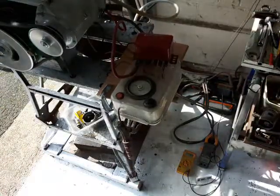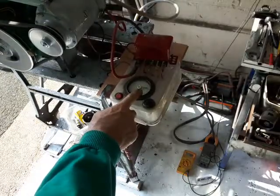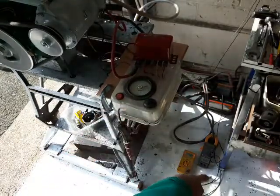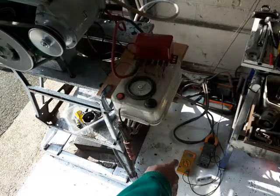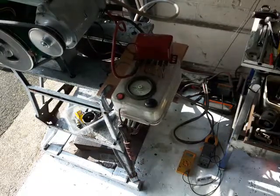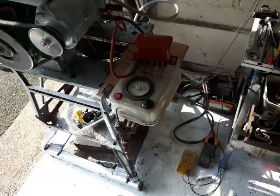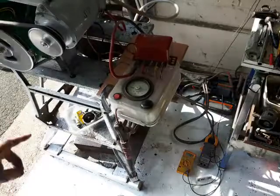I'll give it a little rev — you see immediately we've gone up to about 7-8 amps digitally, and the important thing is the voltage is increasing. I've got 13 and a half here. If I let the revs go down, 13 volts, which is what the battery is, and I haven't got the battery charger on. I'll stop the engine.